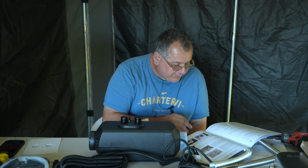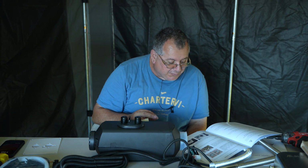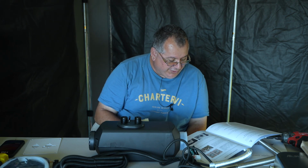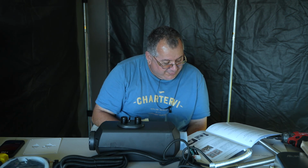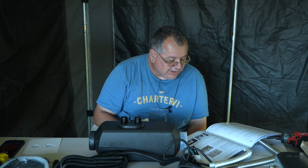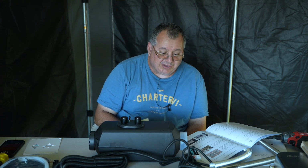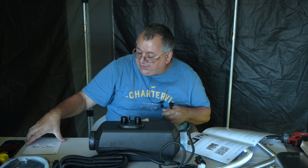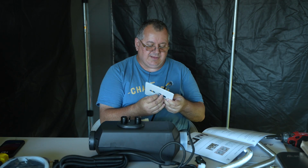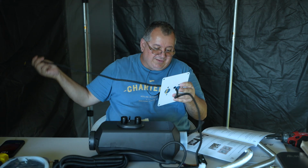So the first step that we have to do right now is to feed the fuel pump power from the wiring harness through the mounting plate cold air void and into the small adjoining void on the mounting plate. Leave around 100 millimeters from the wiring harness junction. That gets fed through into the mounting plate. And now we pull this through.